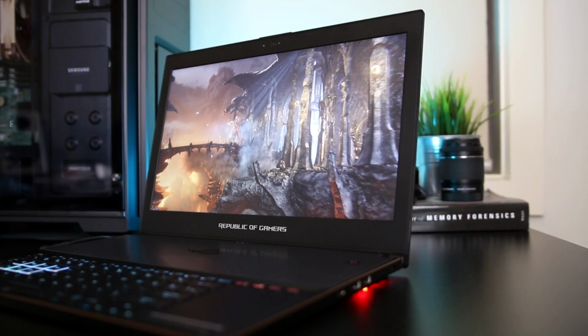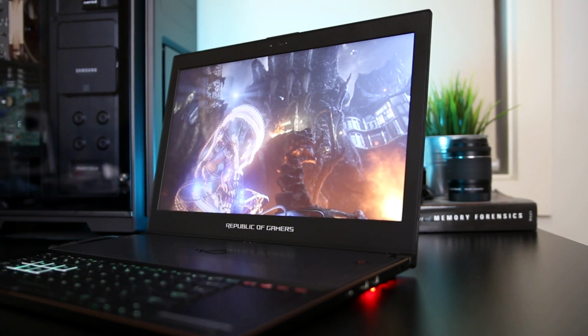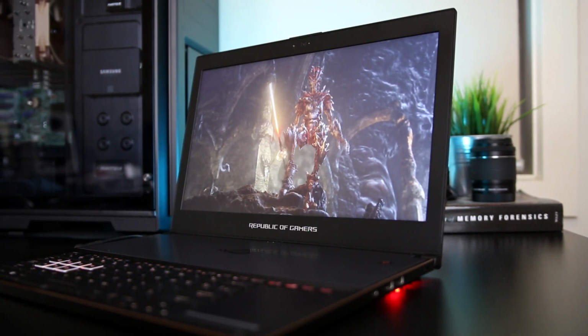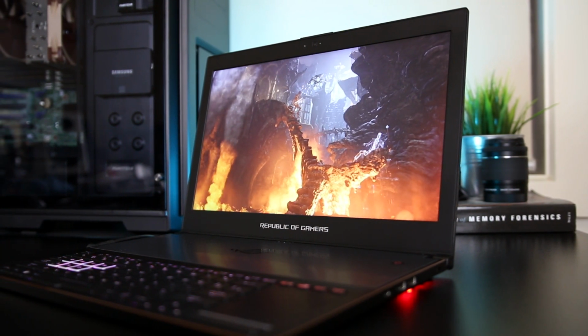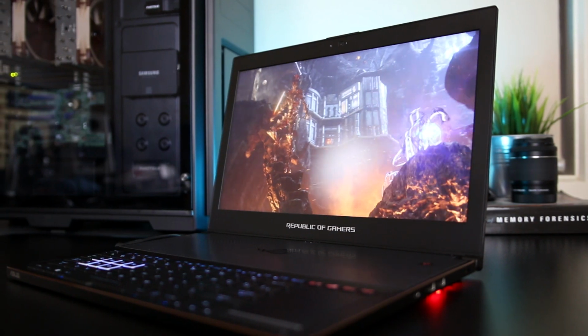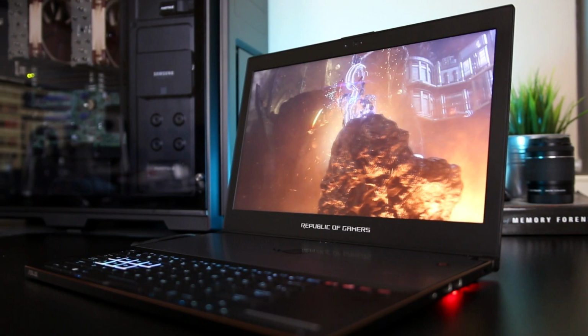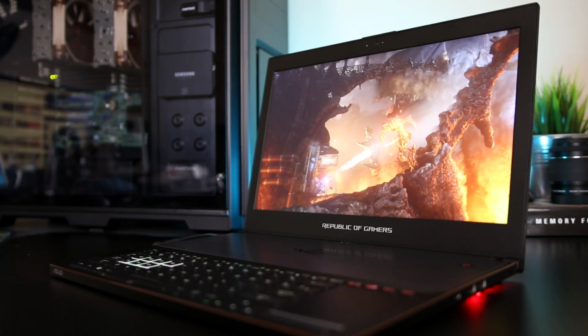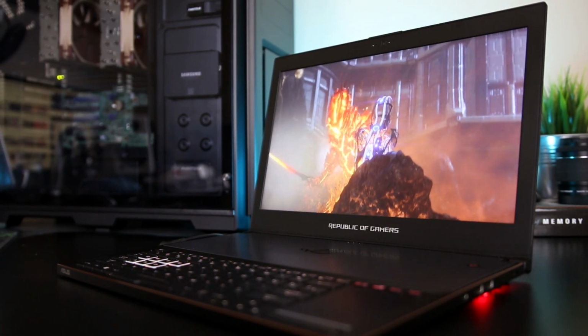I did actually see the GPU core clock boost to 1771 MHz while under load. Even once the temperature had stabilized at maximum, it was still sitting above 1700, so even with the Max-Q design it's still performing quite well, and only seems to throttle back a little bit at max temperatures, and no CPU throttling was observed. But keep in mind that it's only 18 degrees Celsius inside here as it's currently winter, so this could change in a warmer environment.